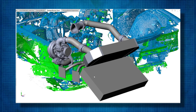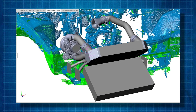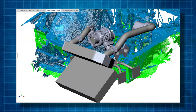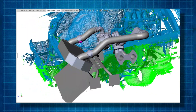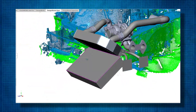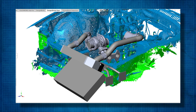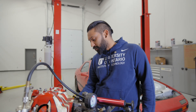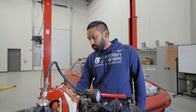So that's it for the CAD design. I'm pretty happy with how it came out. I don't want to be super rigid with the design — I do want Tanner to have the ability to make changes while he's here in case something would be easier to install or fabricate. Overall I'm pretty stoked on the design. Before this engine goes back into the bay I just wanted to give it a quick refresh, redo the intake manifold paint. I did find a coolant leak that had prevented me from going to the track — it's a pretty simple one, just a vacuum cap for the heater core that I had plugged up poorly. I have a solution for that which we'll see in a future video, but for now we're just going to clean everything up so it looks fresh in the new bay.